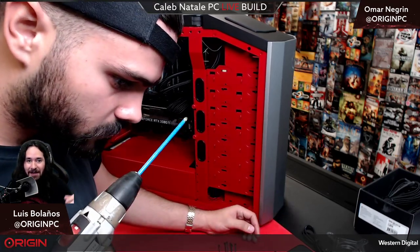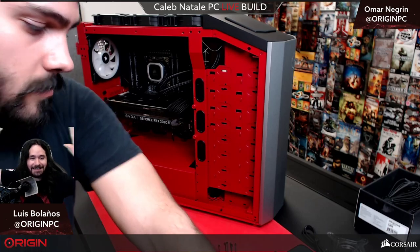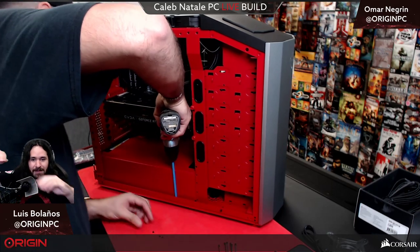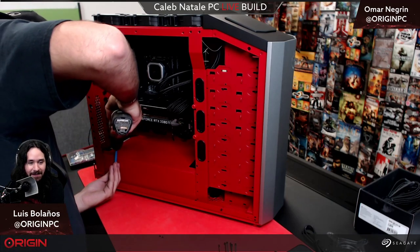Maybe for whatever reason you messed up and had all the fans aiming inwards, and there's no airflow out. No, that's a big no-no. Don't do that. You want to make sure there's at least something that lets the air go out. Air goes in, air goes out. Unless you have some crazy design that I haven't seen before, but that's pretty much the standard across the board.